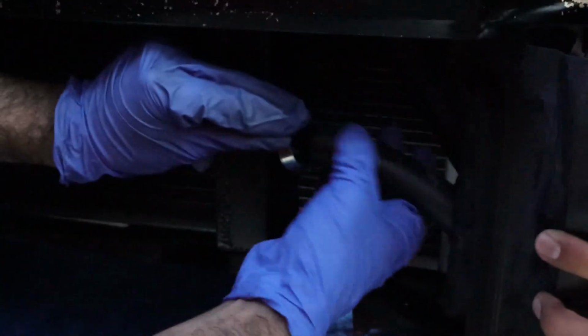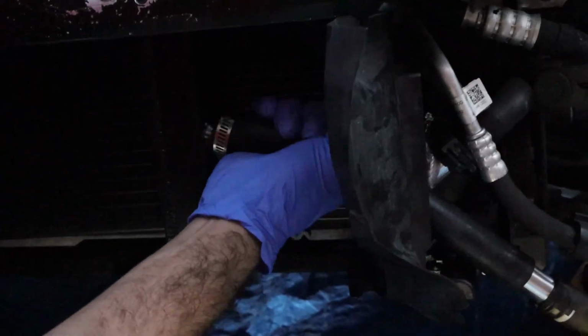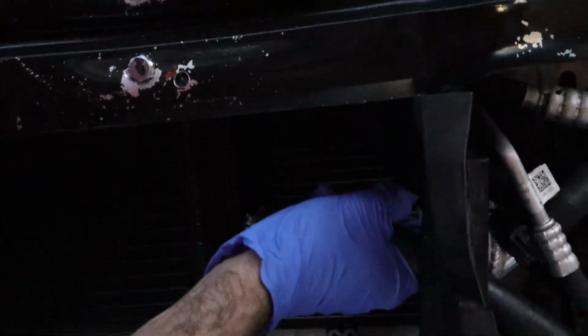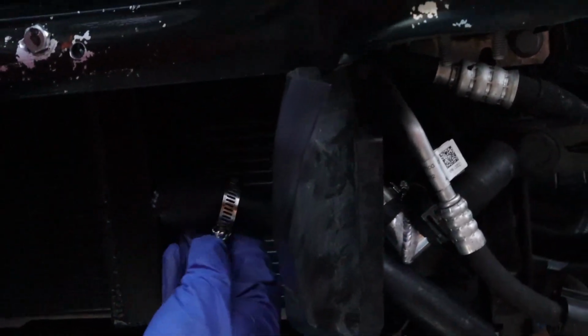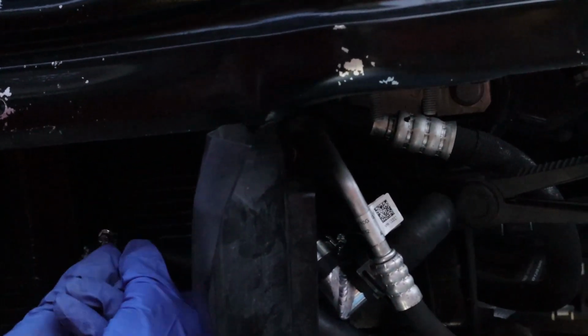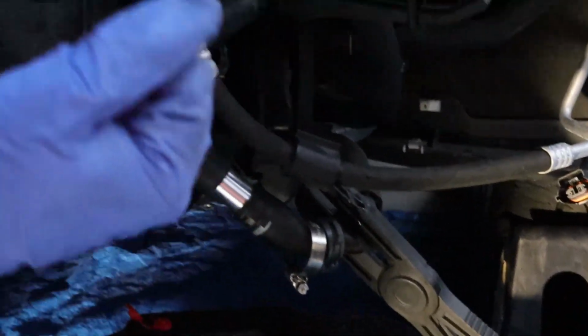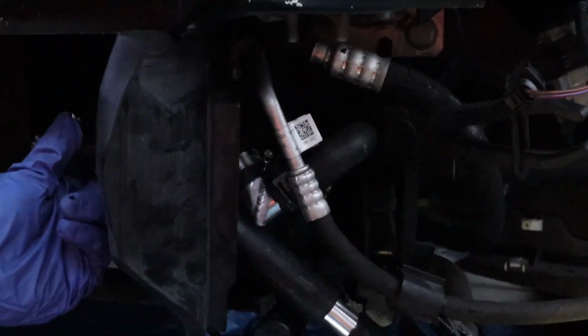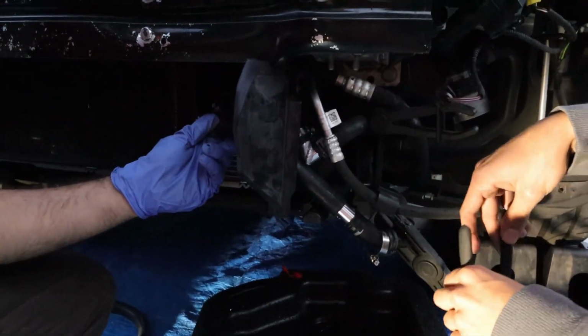Yeah, that flap's annoying. Also, if you guys want, you can take this flap out of the way on the bottom part, or get something to fill the void, because that was in place for the stock heater exchanger, but now, as you can see, it's annoying, so just fill stuff in. So now what you want to do is tie in this right here, and this right there, and that one in the middle, so there's no leakage. Make sure to check everything. After that, we're going to fill this up with coolant, turn on the car, run through everything, make sure we have no leakage, and it should be the end of the install.